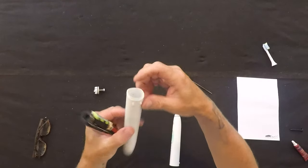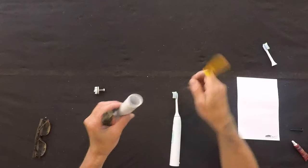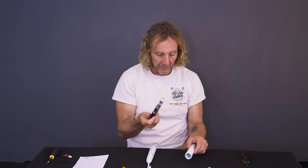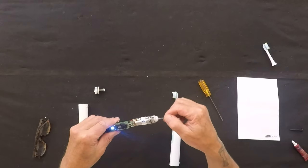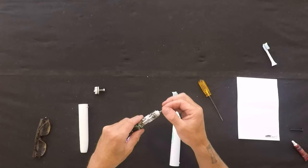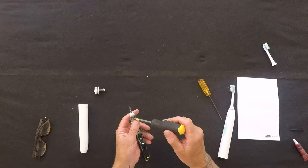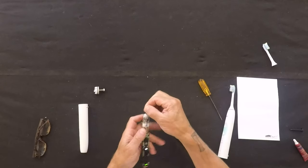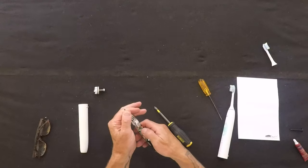On the inside there are two little hooks that kind of stick out. It's pretty easy — you can just get alongside those two little black tabs and pop them out. All right, so now we've got the guts out, and we can pretty easily see this is the problem here, at least on this one. There's a little screw right there, and this is a number one Phillips, which fits right into that screw. As soon as I tighten that screw up — boom, let's try it. Turn it on. And there we go.